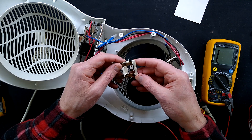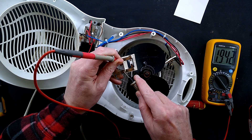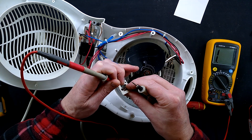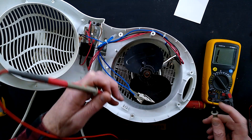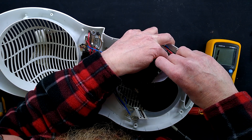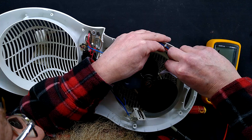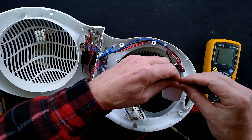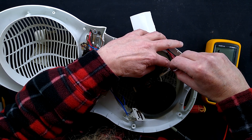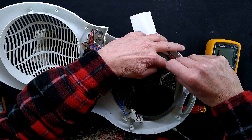It does have the advantage that there's 240 volts open circuit across these, which will help make a connection. Let's try that. Has that helped? No. I wonder if these contacts have been... it's just barely making a connection there. I think with the mains behind it, it would actually just jump that gap and break down the last residue of the oxide. I'll clean that contact down there as well. We'll put the cover back on just for safety and give it another go. I'm going to rip off a strip - common enough technique. This is where I have to be very careful not to pull this contact too far because they really are flimsy little contacts, and they're dealing with 8 amps which is quite a lot.